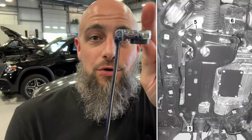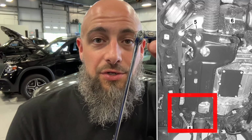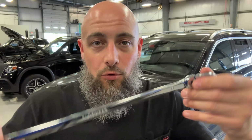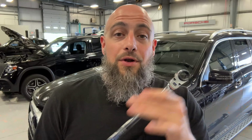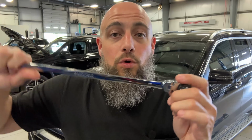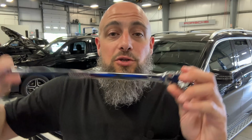We were doing power steering rack bolt recalls on the Mercedes, and this goes over the frame just enough to grab the captured nut where you can't fit a wrench in there, or a socket or a ratchet, anything like that. So another rule I have is, if you can't get it close, get it far. Meaning, if you can't get in there with the tool up close to the nut or bolt because there's other stuff in the way, then get further away and work away from it with your hands and everything away, and you'll be able to get to it, right?